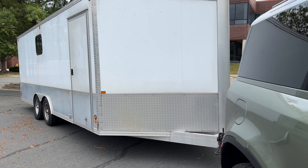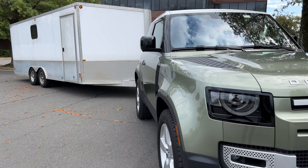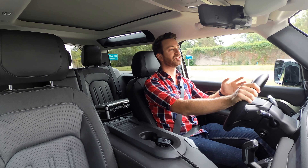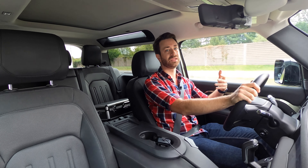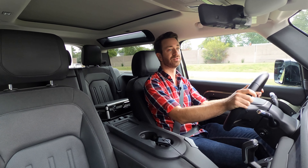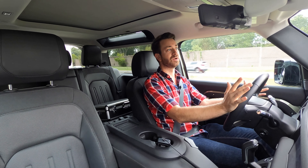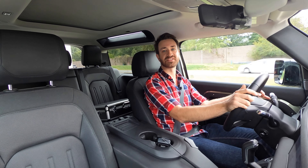But in practical use, I would really caution you against towing something as big as what I'm pulling, even though it's under the weight limit. That's because an enclosed trailer like this catches the wind, whether it's a windy day or you've got a truck passing you — a big box U-Haul or an 18-wheeler. It really wants to catch everything and be pushed around, and ultimately you need enough tow vehicle to combat that. What is enough tow vehicle? Well, you can have enough in a couple different senses.